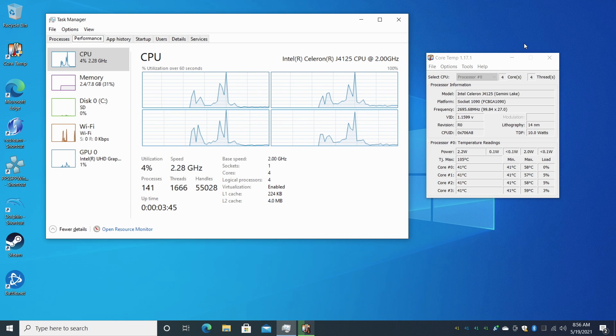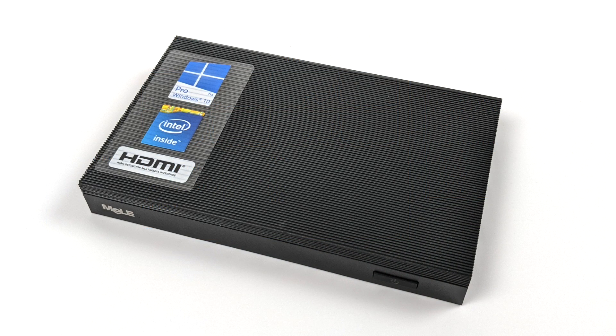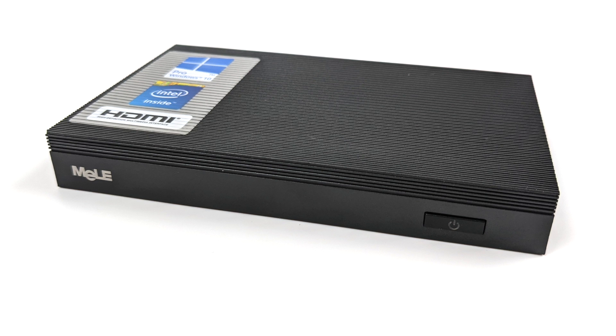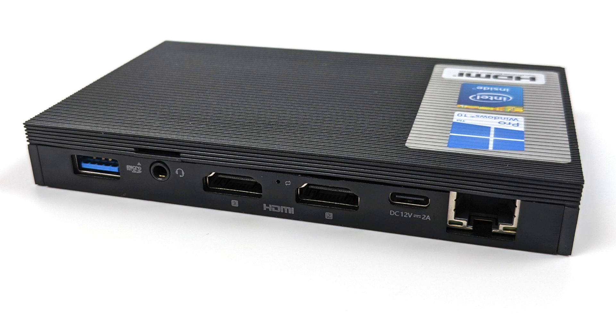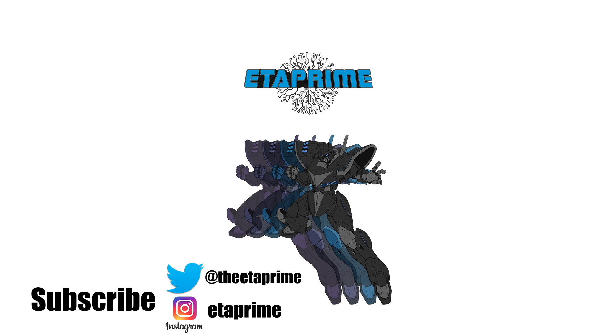Overall I think they've done a great job with this little mini PC. It is silent, and the highest CPU temperature I recorded through all of my tests was 81 degrees Celsius, while it idles around 36 degrees. When it comes to performance, this is basically all we're going to get out of the J4125 — adding another 8GB of RAM isn't going to help; 8GB is plenty with this lower-end Celeron CPU. So if you're looking for a totally silent, low-power-consumption PC for web browsing, email checking, some light emulation, and even some cloud gaming, the Quieter 2 might be a great option for you. I really appreciate you watching. If you're interested I'll leave links in the description, and if there's anything else you want to see running on the Quieter 2 just let me know in the comments below. Thanks for watching!